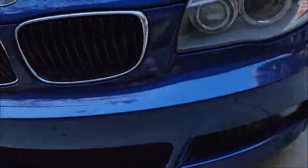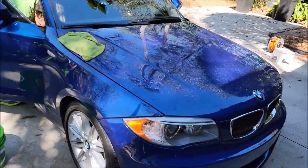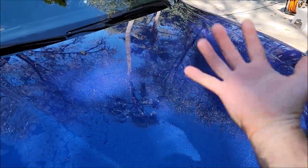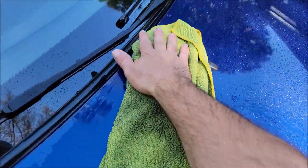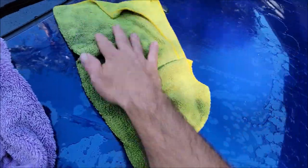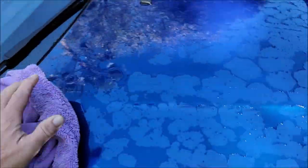This is going to break up all the dirt and grime on there and encapsulate it, so the polymers in the solution are pushing around the encapsulated minerals, dirt, and dust instead of just the dirt and dust directly. This aids in not putting in any scratches or swirl marks. We do half of the hood at a time, and then you dry — that's it. This is a rinseless wash.